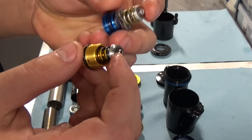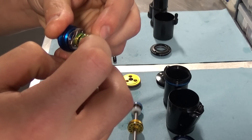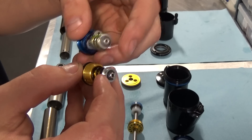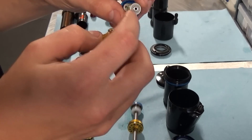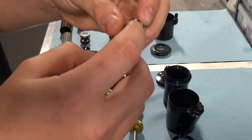The difference, as always, is in the details. For example, this Fox poppet only has a single shim that is able to bleed oil before the poppet spring preload is overcome. The Cane Creek has three. How substantial that difference is, not something I can quantify just yet.